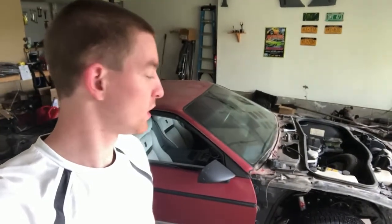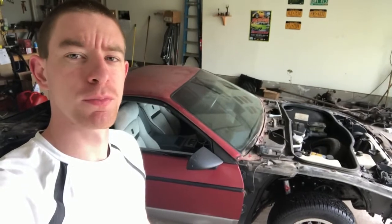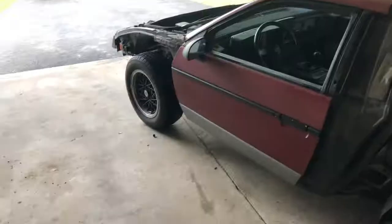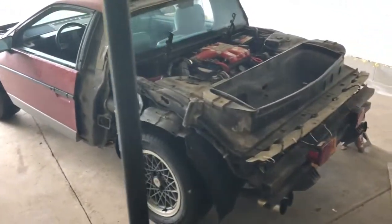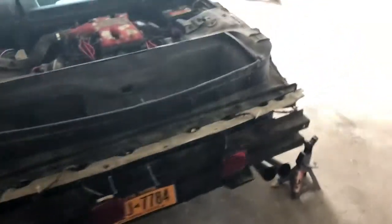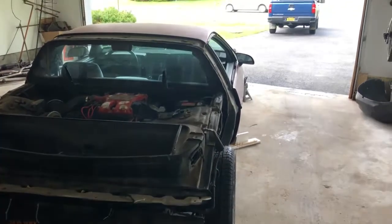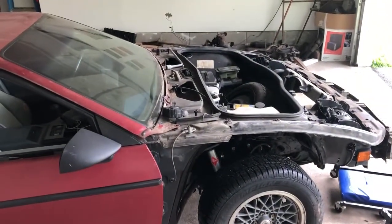So that's a quick, short, easy way to do a DIY home string alignment. Both tires are within an eighth of an inch of straight and both have about an eighth of an inch of toe-in, so that'll help keep the car a little bit straighter. It's quick, simple, and easy — it'll get you a good enough alignment to get you to the professional alignment shop. If you like what you saw please leave a like, leave your comments below on how I could have done it easier, and if you want to see what I have in store for this car be sure to subscribe. Remember, you can always DIY.